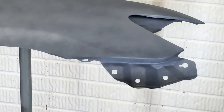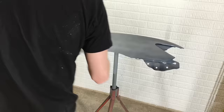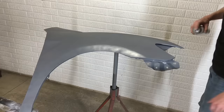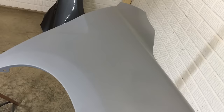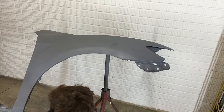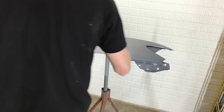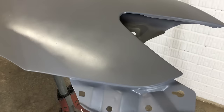A safe way to see if your coat has dried is to scratch it with your fingernail in a hidden area. The second coat of primer sealer should be just like the first — keeping it light, doing the edges first and then the main surface. I see I have a thin area here and another here, but those will be covered up by the third coat, which is the wet coat. This final coat of primer is a little heavier than the previous coats — not thick enough to produce any runs, but heavy enough to look kind of glossy once it's down. This helps to fill in any of the lighter spray areas from the first two coats.